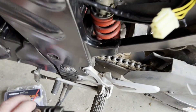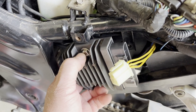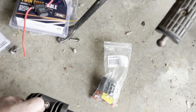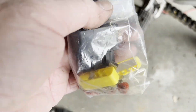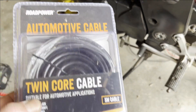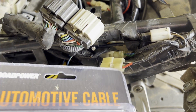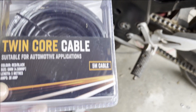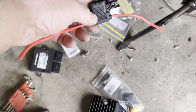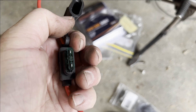We're going to tape up and isolate the old connector, chop the three AC wires off, and mount the new unit. To get it to fit, there's a bracket that's been painted and waiting to dry. We'll be using 6mm wire and sending power straight out of the regulator rectifier via the dark gray plug, straight to the battery via a 30-amp fuse holder that's already got a 30-amp fuse in it.